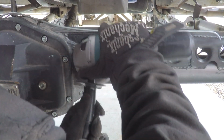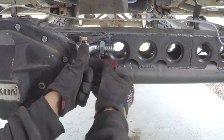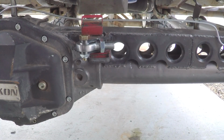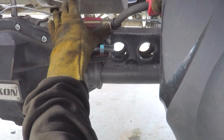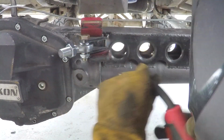Once all the overhead parts were installed, it was time to install the hydraulic ram. I chose to mount one end to the truss on the axle using weld-on tabs, and the other end on the tie rod with weld-on tabs as well. The most important part of installing the ram is making sure to check clearance throughout the complete travel, and make sure to center the ram in its travel along with centering the wheels to find the mounting location for the other end.